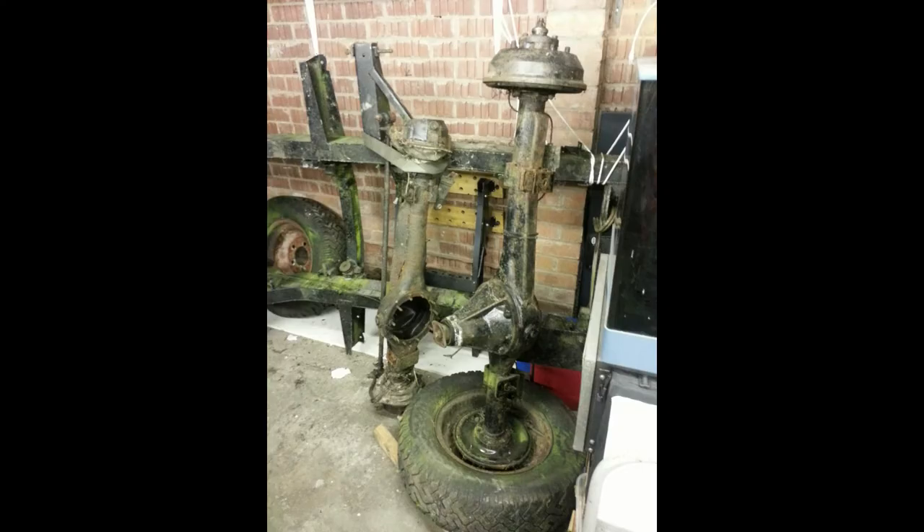You can see by these images that the rear axle again had a little bit of surface rust. I stripped that down. The insides I knew were in good condition because my father had done it a few years ago — I checked them out anyway. But basically I took the outer casing of both axles down to bare metal, etch-primed, and then painted them back up again. I did have all of the parts for the front axle — the gears and the bars — so they went in, and I was then able to get a rolling chassis.